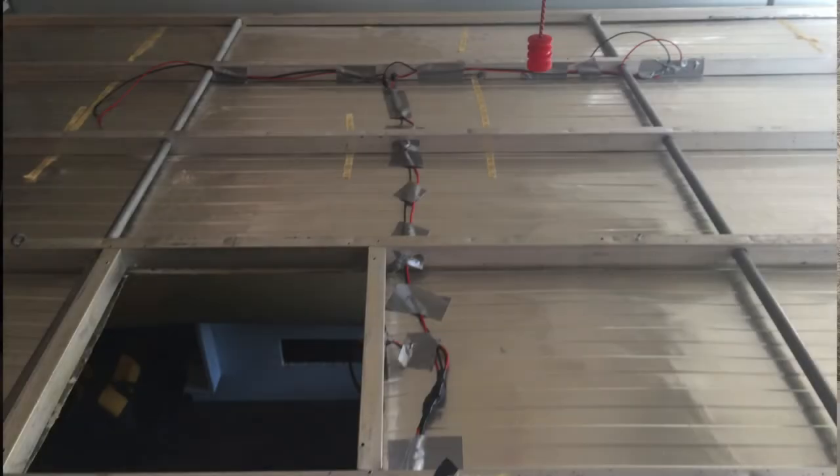What I did was find some old vacuum hose and shove it into each of those frame pass-throughs, glued it up, so the wire passes through that nice plastic area instead. Totally jerry-rigged, but it's definitely going to do the job of protecting the wires. After the wires were run everywhere they needed to be, I taped them to the roof so they weren't moving around or disturbing the insulation. I also took pretty detailed measurements of where those wires were, so if anything ever happened I could find them without tearing apart the entire roof.